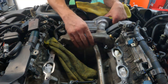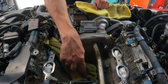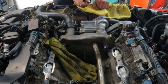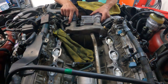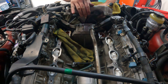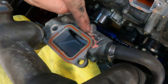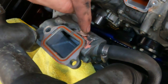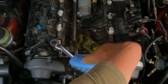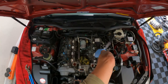You just bang on this a little bit with a hammer and it'll come loose. Make sure you have rags down here in the valley — it seems to drip down and around to your skid plate and underneath the car. You're going to have to do FIPG here. This might explain why I had some leakage going on. The last stud.